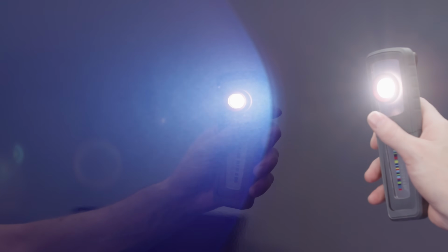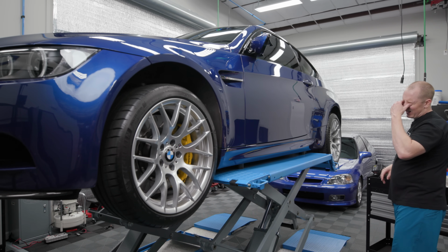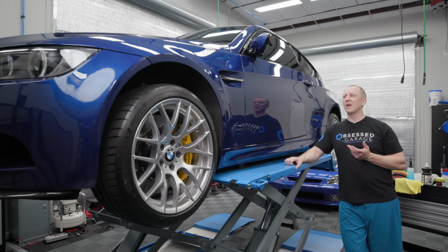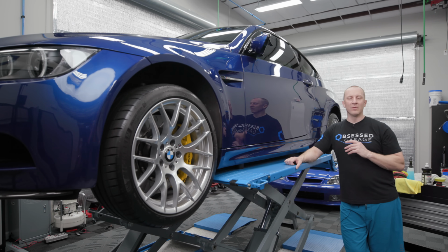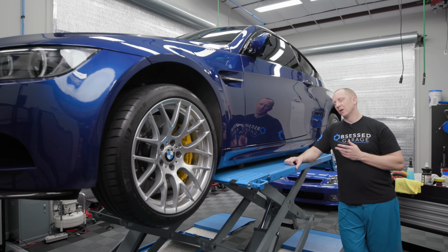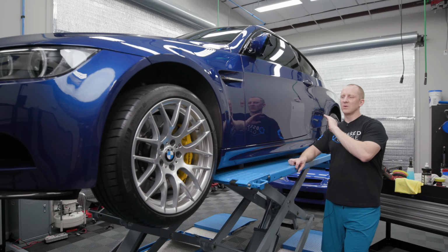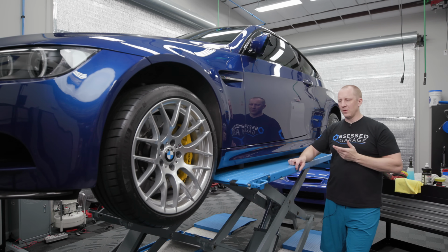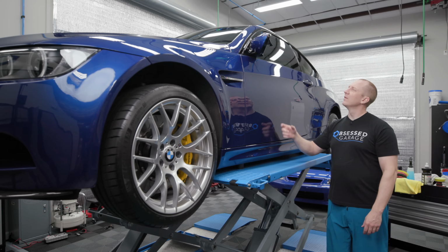Really great. This side wasn't too bad, but the other side was all water spotted up. What happens when you wax a car, when you do a sealant and wax like I had on this car, is as it fails, you end up having to wash harder and dry more, which means you end up marring and scratching the surface. So when you're waxing, this is why you'd want to do a decon and then just a quick finish polishing like what we're doing now, a single step. You'd want to do that more often than not so you don't end up with marring and scratching and stuff like that. But man, it leaves such a nice finish.